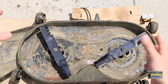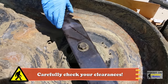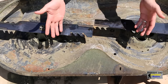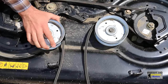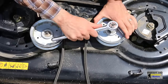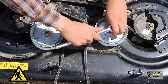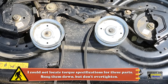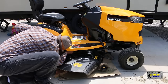I want to do some final checking with the clearances. Although we're sure we've got the right part number and matching blades, let's do a sanity check to ensure they won't hit the deck sides or reach each other. As you can see, there is plenty of clearance. Flipping the deck back over, let's check the tightness of these idler pulleys — I've seen some videos where these weren't torqued down properly from the factory or have come loose over time. We're just going to snug these down a bit. Make sure the pulley still spins freely after tightening. Let's reinstall the deck in reverse order.